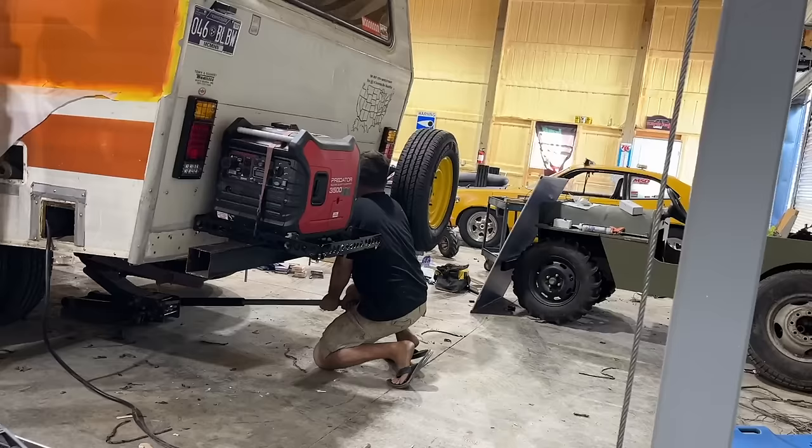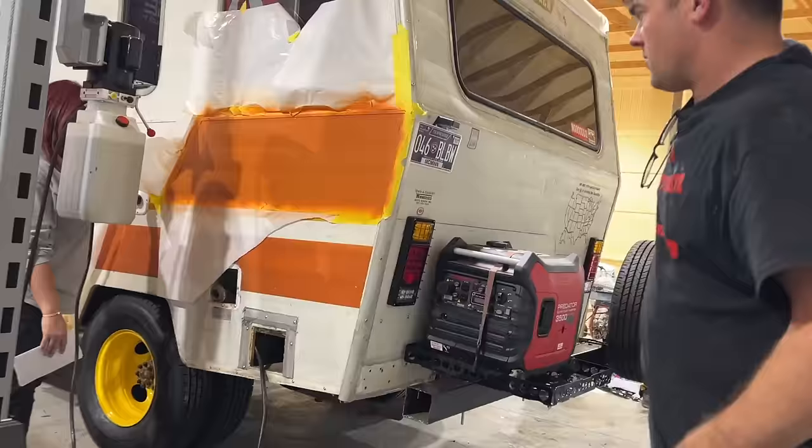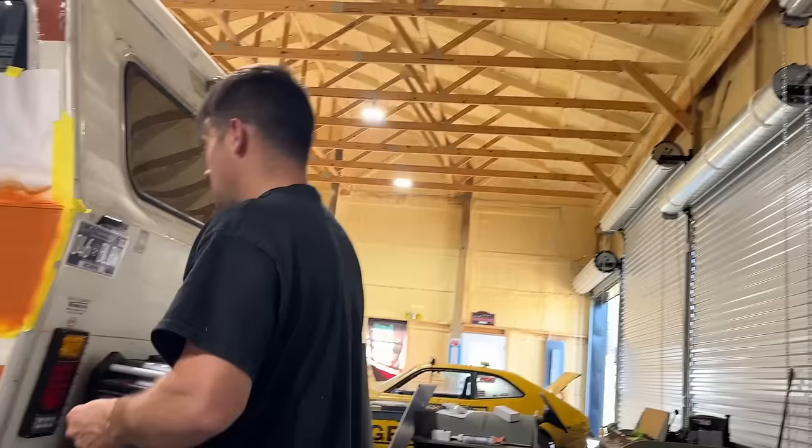So the reason we went so tall with them was to help our highway gears, which actually I was better off than I thought. It's got a 410 gear, 31 inch tall casing. With our overdrive 46RE transmission, we should be right at 2000 RPM at 70 miles an hour. So should be perfect. A lot better than it was back in the day with that 727 in it.